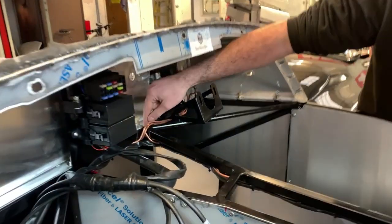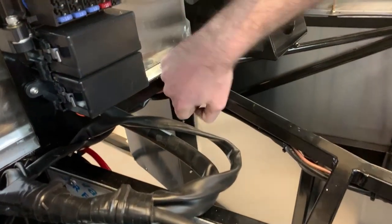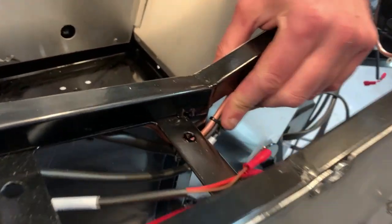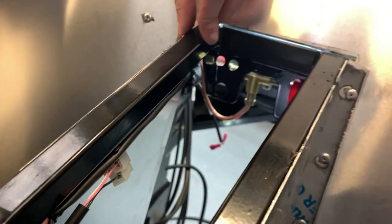You've got your rear brake line coming off your cylinder, clipped all the way under the right-hand tunnel side. Coming around, keeping it as tight as you can here to give you room for the handbrake cable. Then it comes up, loops around again just to clear the handbrake cable.